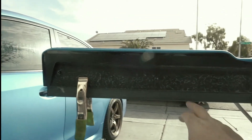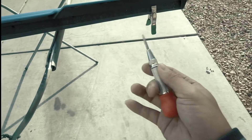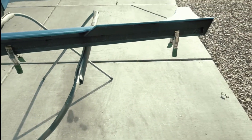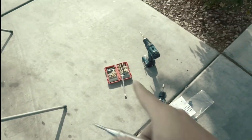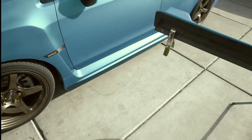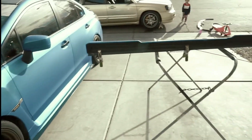The other side step had holes already, so I just punch them. This is a really good tool I like to use when dealing with fiberglass — it's spring-loaded. You push where you want to punch and it creates an indentation, and then you can see the drill bit go in and drill the holes properly.